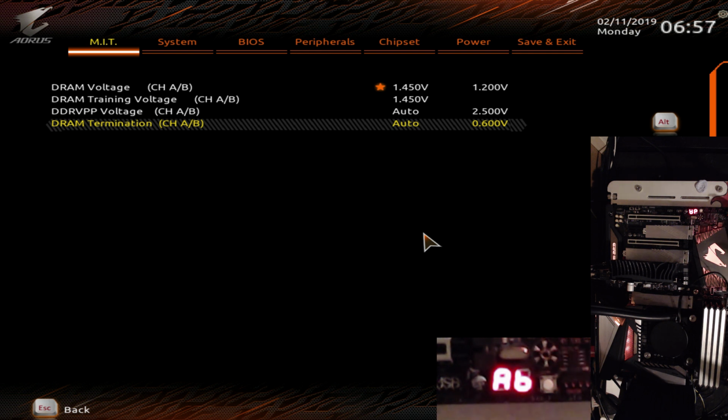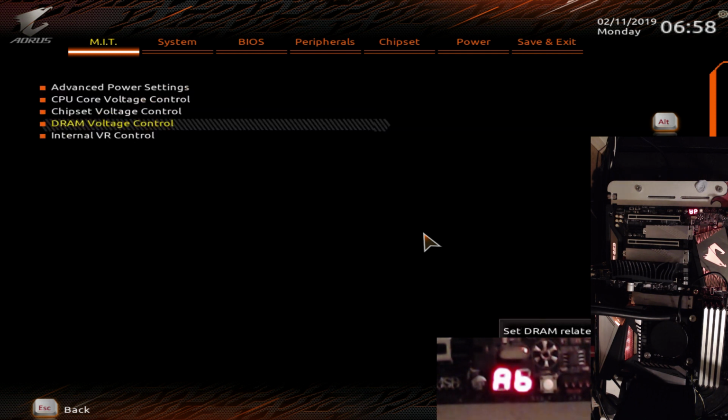If you raise your memory voltage and then you start failing long stress tests, that basically means your memory sticks are getting a bit warm. It doesn't mean they're literally on fire, okay? It's just a stability loss due to a slight temperature increase, and it's completely normal for memory to do this. If you are in a relatively warm environment or don't have the best case airflow, your systems vary, you may find that it's not optimal to just mash 1.5 volts into your memory kit, even though that is generally safe for long-term use, because at high load for long periods of time, it'll get the memory so warm that it'll lose stability. Obviously you can also just loosen the settings at that point and still run 1.5 volts, though at that point you can probably lower the memory voltage too. So, yeah, that's worth noting.